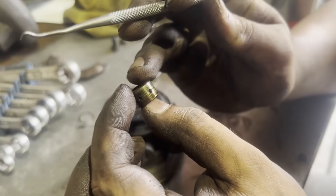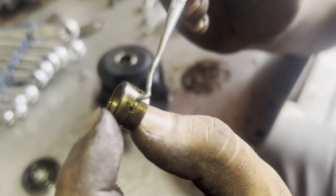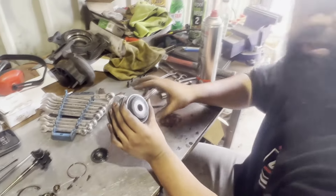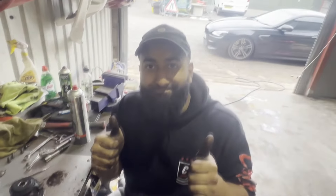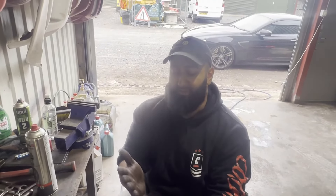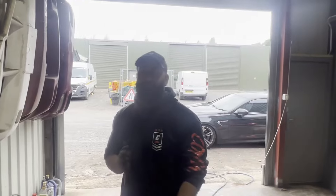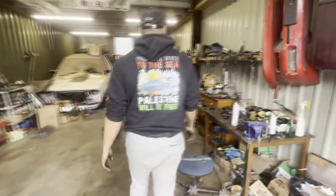There's not real big scoring but a little - you can see it through the center. Something's gone through there. You can hear that - there's definitely a ridge in the middle, it's a little scored. That's it apart, that's everything. Ali's now learned how to rebuild his turbo at home. If you want to learn how to rebuild your turbo, in my workshop I can let you do the service. That's everything disassembled.